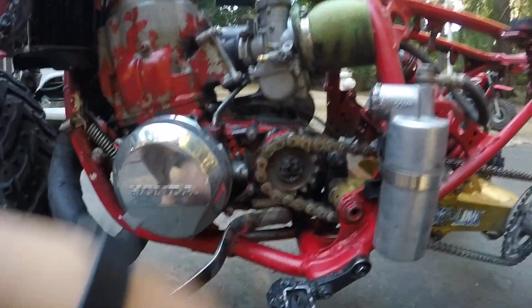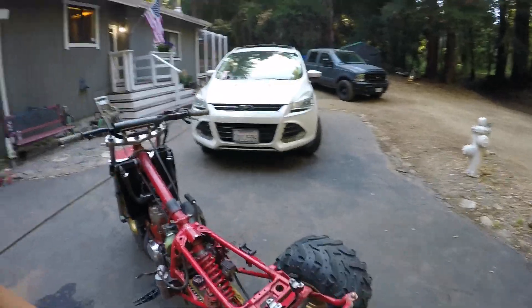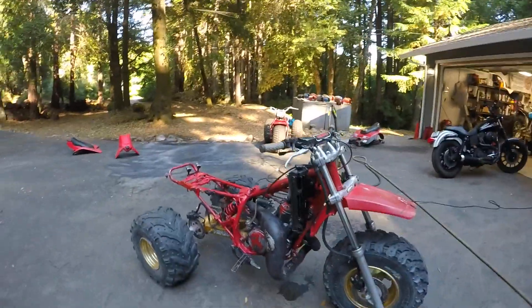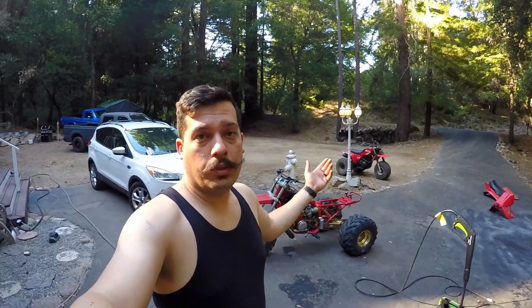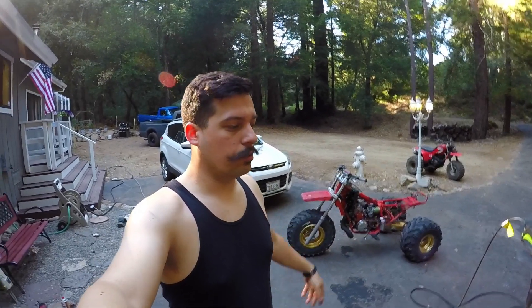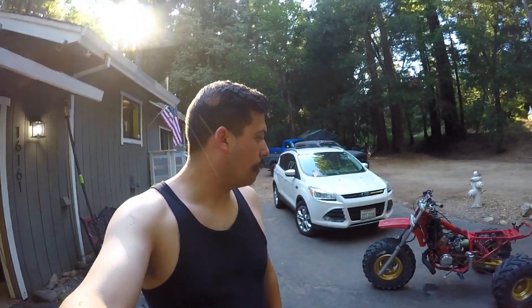Total hackery, but I did get to the engine numbers, which was cool — I figured out it's a 1990 engine that's in it. We definitely learned a few things about the old 500-250R combo Frankenbike we've got going on. We'll have to take the engine out, split the cases, and I'll look for new shafts — probably two, because the shifter is also welded on, which is just insane. But the thing does run pretty good — I rode it around and the motor itself is good, it shifted fine and all that, so that's positive I suppose.